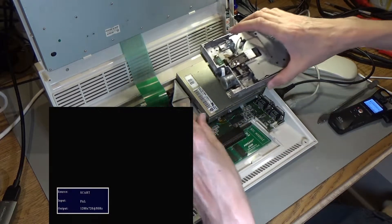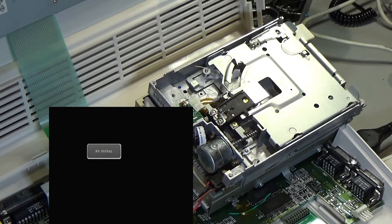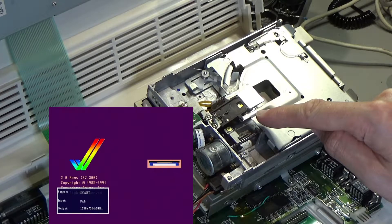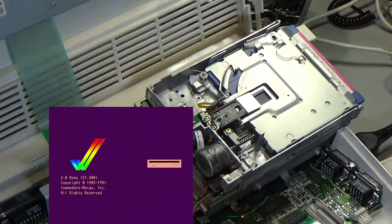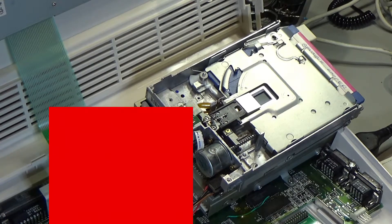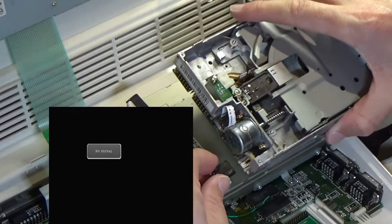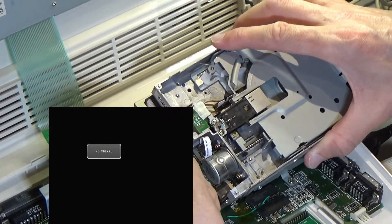Let's turn this off and plug this drive in. Hopefully I didn't put the cap in backwards — let's see if we get anything better this time. It's doing something, and it didn't do that before. So maybe that cap was our problem. Let's see if it can boot this. It's spinning now — it didn't spin before. It's getting a red screen though. That's disappointing, but it is getting further and it's definitely spinning the drive now, which it didn't do before. So that cap has definitely gone bad — you could see that it leaked and left something on the board.